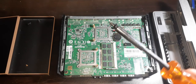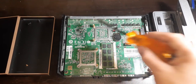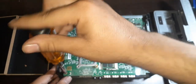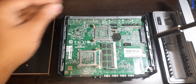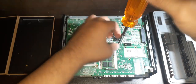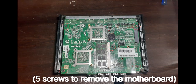The first order of business is to remove the old thermal paste and add fresh thermal paste to the CPU in order to prevent overheating or frying the CPU. To get access to the CPU, we must remove the motherboard — technically tear down the whole system — as the CPU fan is located at the bottom of the motherboard. Using your Phillips screwdriver, remove all 5 screws holding the motherboard in place and keep them somewhere safe.